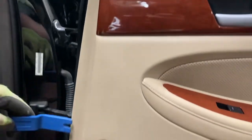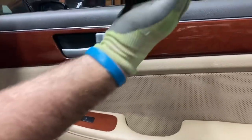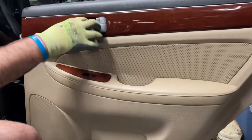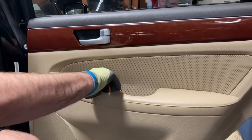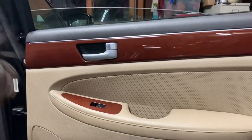You'll just go around the door panel popping it all the way around to get all the clips. And do those screws. You'll get it out of the window seal. Then you'll have to take those cables off of the door handle and the lock. And there's a plug-in for the power window switch, and then there's a plug-in for the light that shines on the door.